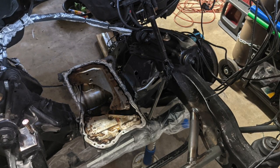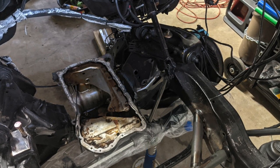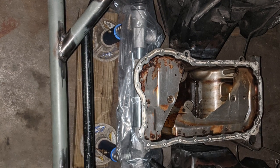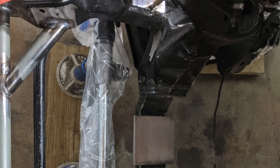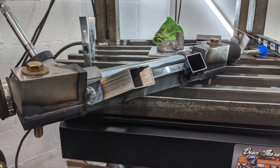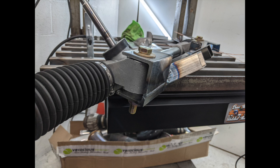After I had the realization that the Mark II GTI rack was not going to work — because it's a rear-mount rack versus a front-mount, which changes the orientation of the rack and pinion, meaning left is right and right is left — I purchased this Mustang II rack. I like this rack because it has solid bolting points, nice bushings you can mount which help with vibration, and the input shaft for the pinion is nice and long, making a good angle for the steering column output.